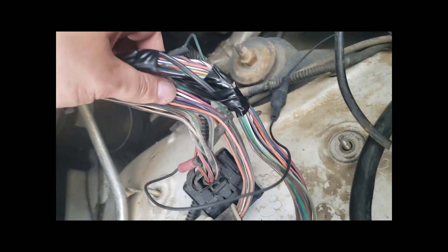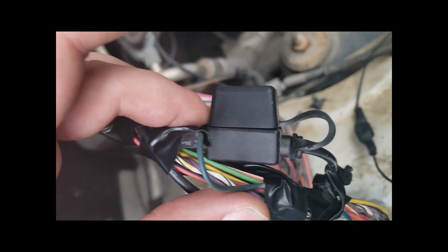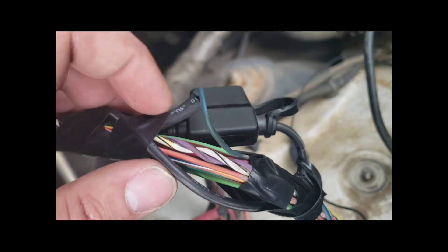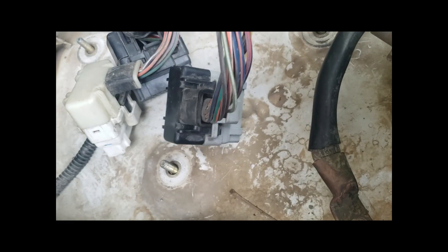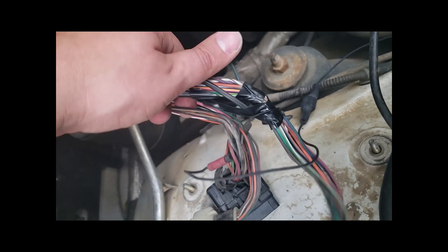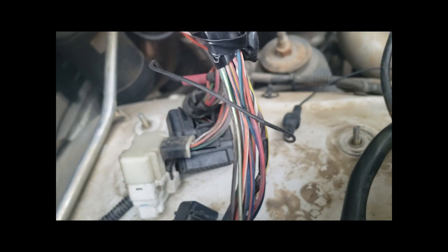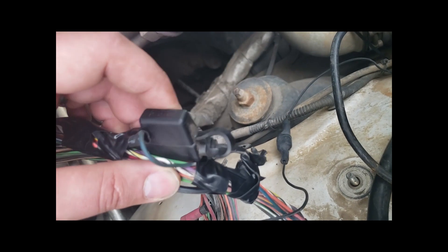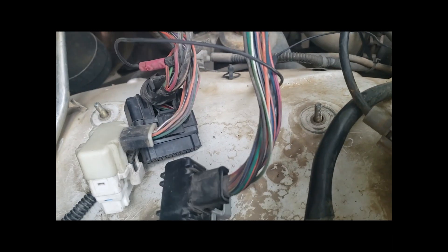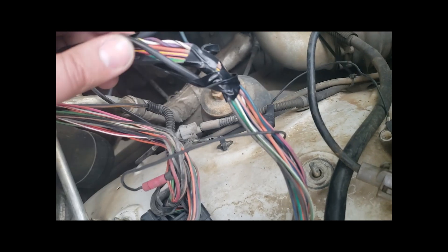So as you can see with my little half-rack ghetto rat's nest — took the blue wire from this third connector, solid blue, and cut and crimped it. It's a fused circuit now, so now it won't be damaged by the whole thing there. It protects the PCM from alternator charge circuit voltage.